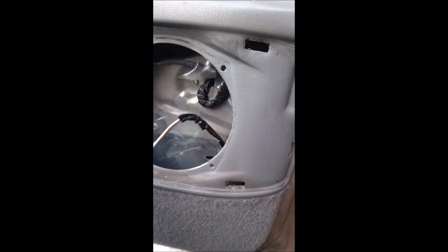See the space in here — there's no window regulator in there unlike the front door. Be very careful when you put these extensions on there, because when the window comes down to its lowest point, it hits the harness. What I had to do was position the speakers so the Boss label was upright inside the door, and then angle the wires downward off the prongs. I put a zip tie right behind the connector so the extension doesn't push the wire out into the path of the window regulator when it goes all the way down.